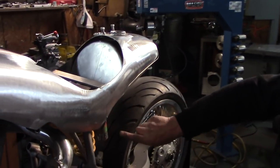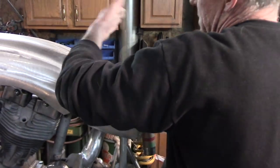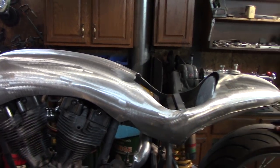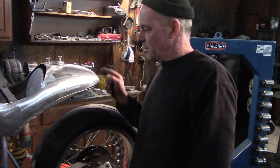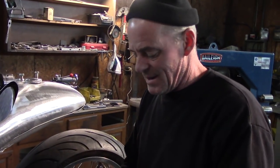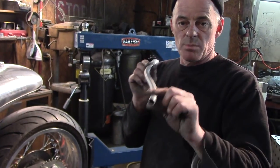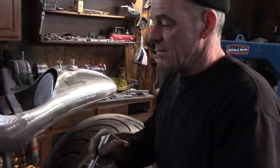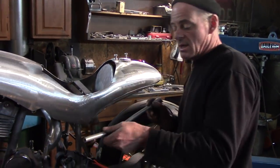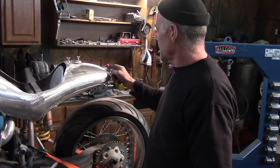I'll weld that in — get it a little straighter, weld that in. It's going to be good. We'll have a seat. I've got the battery under here because I could have the electric start — it's going to flip up for access to the battery and some electrical stuff in there. The one thing that's tricky though is I want to run a tail light here, but this is going to be full of oil. This is my housing for a nice bright LED light, and I've welded it to this piece of 5/8 aluminum tube. So I'll weld that in there and have this tube running through, coming through this bulkhead in the tank. I can run my wires in so I can have a nice recessed LED tail light in the back here even though it's full of oil — I guess it's an oil-cooled tail light.